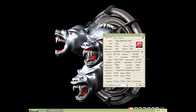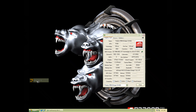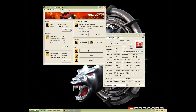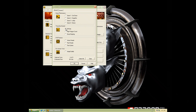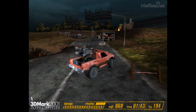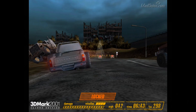Okay, here we are — we can see eight pixel pipelines. So let's run 3DMark again and we should see a doubling in performance with the texture fill rate and also a higher 3DMark result in general. We're gonna run the same tests: the fill rate and all the game tests. You also need to look out for graphics artifacts and any glitches — apparently a checkerboard pattern is very common. But this card seems to work fine, no issues. Let's run the benchmark and we'll be back shortly.